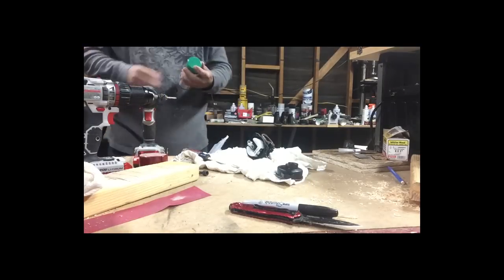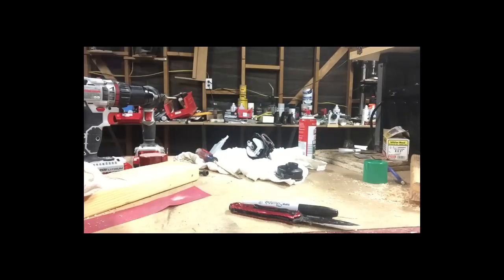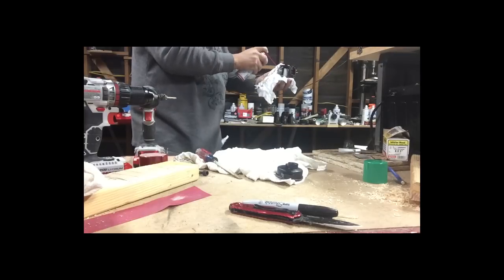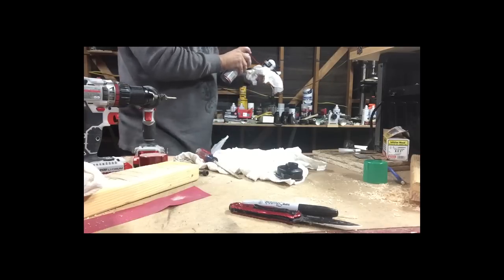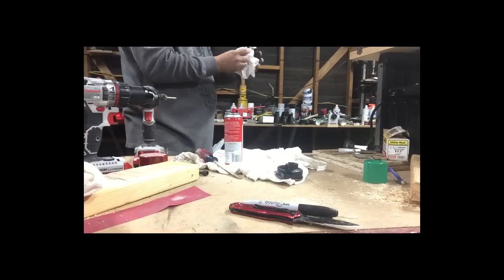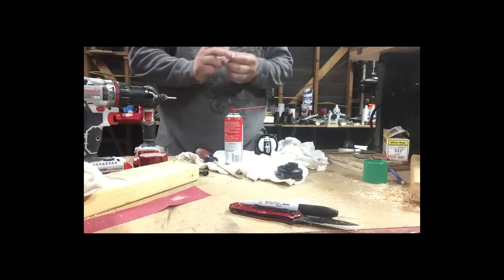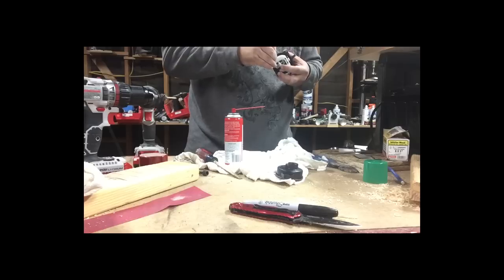Here's the carburetor and choke cleaner I'm using for small engines — I got that at my local hardware store. I'm just going to spray this whole thing down on the inside and the cap to get all the gunk out, any water that might be in there. There are some portholes that I'll be spraying and cleaning out — just want to make sure you get this thing cleaned out really well. Then I'm going to take a small wire to those holes to clean out any junk that's inside.